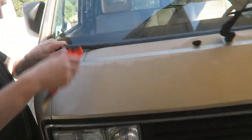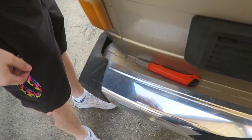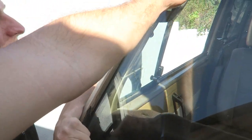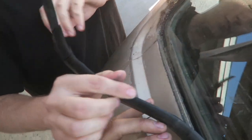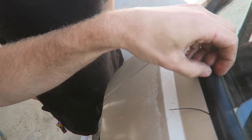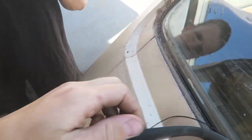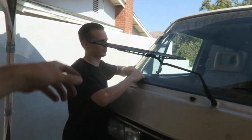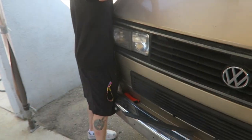Just had to make a quick pit stop over at Ace Hardware and we picked up this knife — it's a carpet knife. Basically you run it right behind the rubber, like this, and it just pulls back and you can see where the glass ends and where the rubber still is at. You have to pull the blade towards you when you're doing this. But Adam's gonna go ahead and finish off the rest of the window. Come along good.